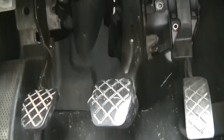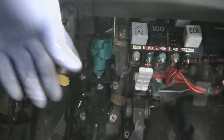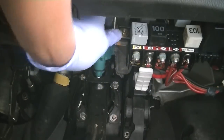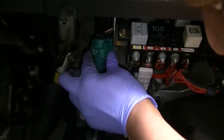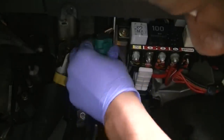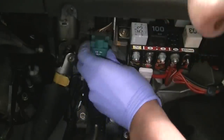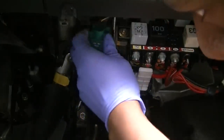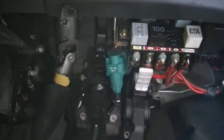This video is going to be very easy — it's just changing a brake switch, which can sometimes cause engine management lights to come on. You just grab underneath — that's the green thing — and turn it anti-clockwise about a quarter of a turn, and it pops out. It really is that simple.